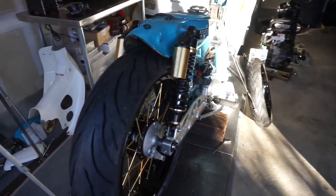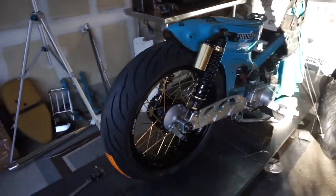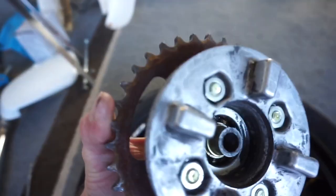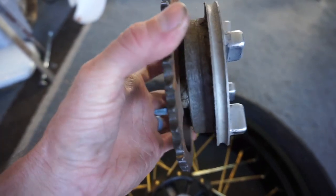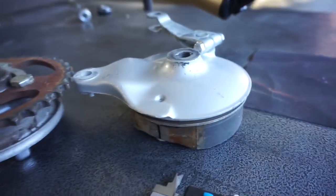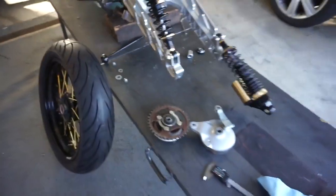There's so much work to be done. I had it when I had that other wheel, but this tire looks better anyway. It's a little overkill, but it looks sweet. I got the wheel pulled and this guy just pops out of the cush drive there. It looks like I'll probably have to do longer bolts, but I'll put spacers right behind the sprocket there — five millimeter. If I need to go a little bit more, I can just slide a washer in there. Making some custom stuff never is easy, but it sure is fun.